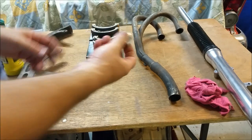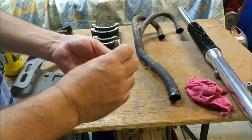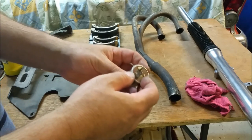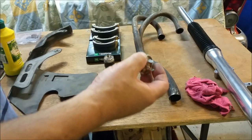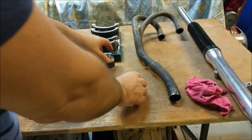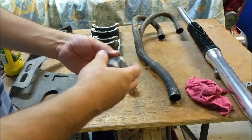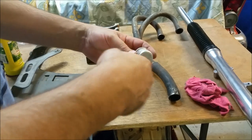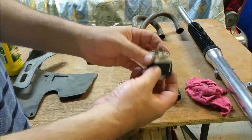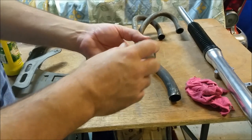Flasher cans. The bike had this one — they're six volt flasher cans. This is a three-pin one, but we're only using two of the pins. Traditionally the electronic ones use a third pin as an earth. I don't know whether it's electronic or just a bi-metallic strip. This is one of these parts bikes and it's the right part. If I can resurrect this to make it work properly, that's the way to go.